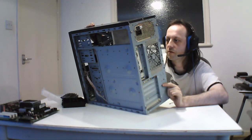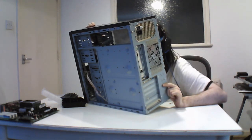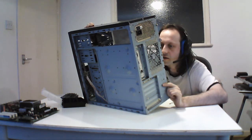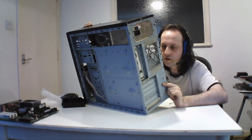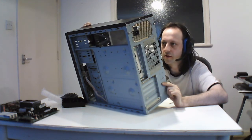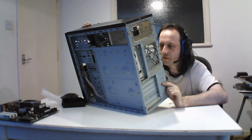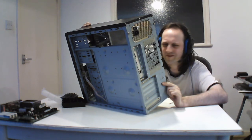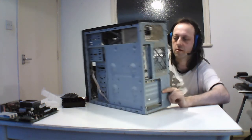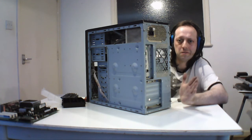It was 2009 or 10 I built this, so yeah, it's over 10 years old. And when DDR2 was coming out, so yeah, this is a good system board, but it's aging because there's a capacitor failing on it, and same with the power supply, the caps are failing, but the board still works, but it's temperamental now and then, but it still works.